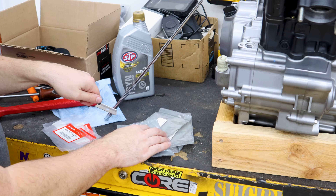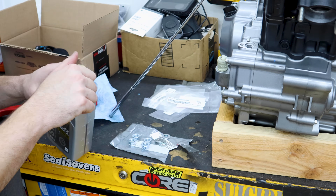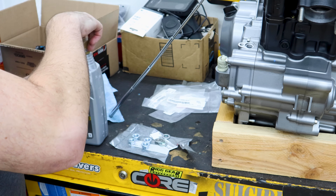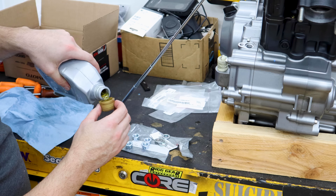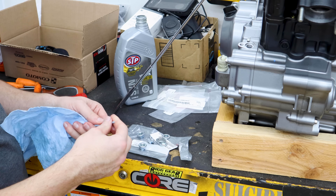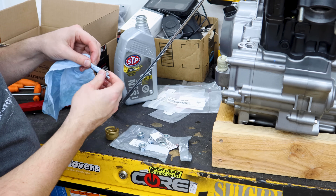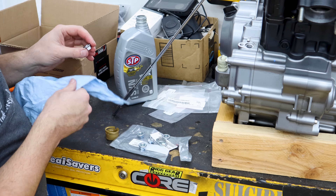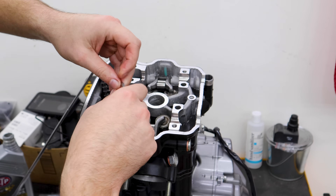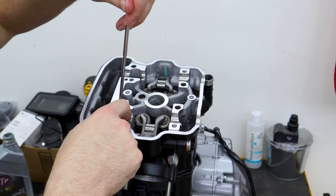Now I can open up a bunch of new Honda parts. You should put a little bit of oil on the threads of those studs — not a lot, because too much oil will hydro-lock things. I can't really reach them anymore so I'll just put a little dot on each one and use a piece of floss to soak up any excess. There should just be a light residue in the threads, but you do need that to get proper torque.